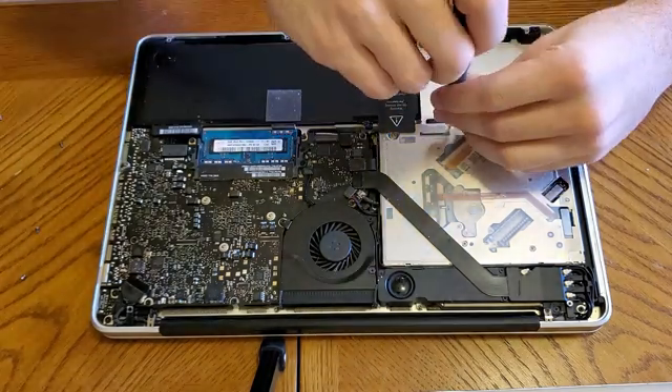The small one is laid down flat. Now we can plug in the hard drive — it only plugs in one way. You can look at the connectors right here and look at the connectors on the cable. You'll see these pins on the side; you don't have to worry about those. Make sure it's snug — don't pull on the cable when you do it. The hard drive has tabs on the sides; you're going to want to slide those into the bracket first, then it lays down flat. Then take your other bracket and put it on top. We're going to screw it down — this helps hold the cable and the hard drive in place.